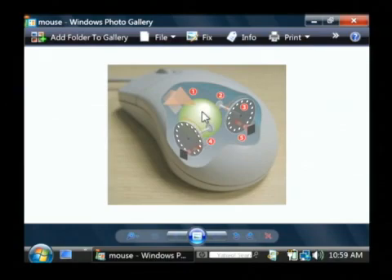Attached to that little ball, kind of rubbing up against it, is a tiny little roller that rolls along with the ball. So as this ball rolls, kind of like a gear, it will also turn this roller, which will turn this larger roller that has a tiny device that detects that roller as it's rolling.